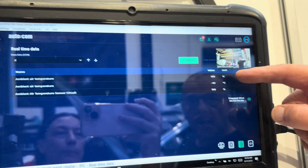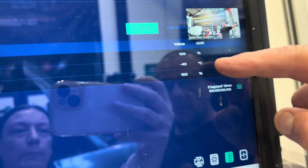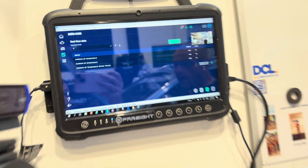I'm in the instrument panel and it's run the checks for ambient air, showing minus 40 degrees Celsius. For those that don't know, anytime a temperature sensor is showing minus 40, that normally means the sensor is open circuit. And as it happens, it is on this vehicle at the moment - open circuit because the bumper's off. But even when it's connected, there's no temperature display in the instrument panel and it's still showing minus 40 in the live data. So where does it live? Let's show you.